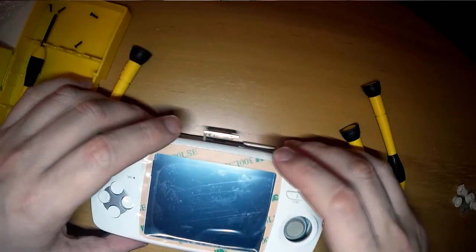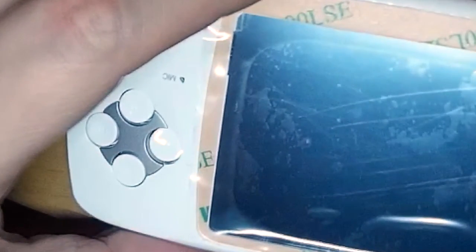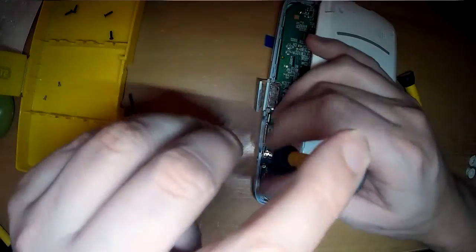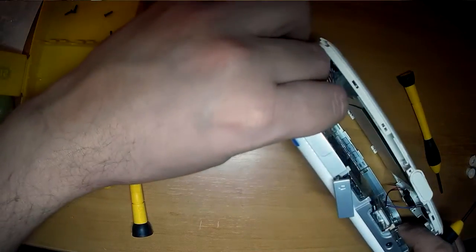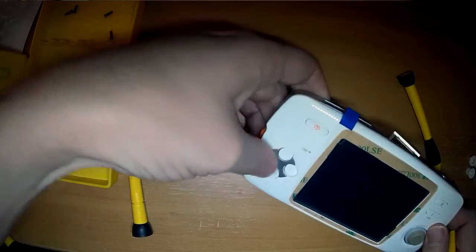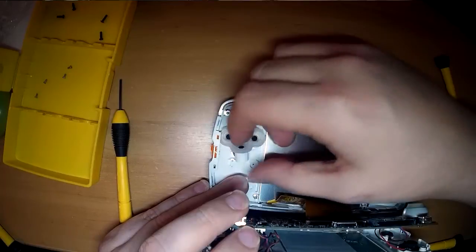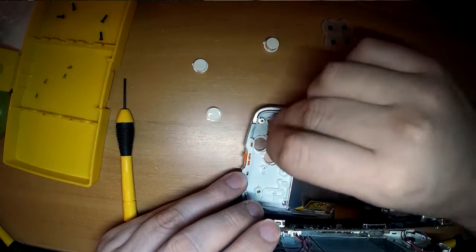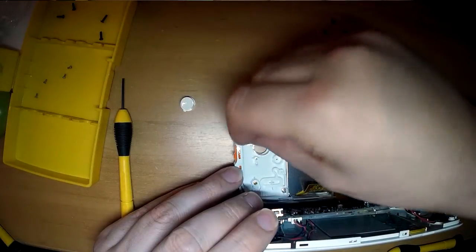To put the unit back together I stuffed this up. The buttons on the left were not actually poking through — I thought you'd just squeeze the thing back together and they'd pop right through. But after I put the whole lot together I realized I couldn't get the board to sit flush, and I looked at the other side and realized the buttons were not actually poking through. So I had to pull the whole thing apart again and align all the buttons so they went in with their notches facing the right position.